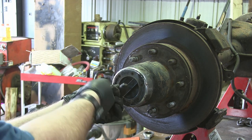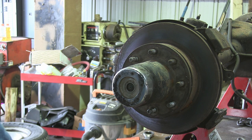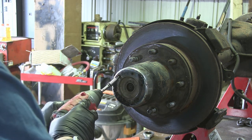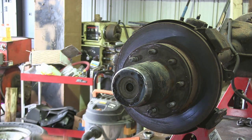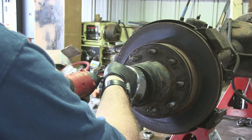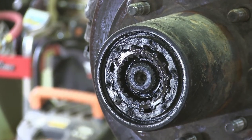Now we're going to start on the hub. First we need to remove the Phillips screw in the middle of the selector switch. On the outside, take these bolts out — they're a T20 on my truck. Remember this is spring loaded, so loosen up these bolts a little at a time. Before you take the last one all the way out, put your hand over it so it doesn't fly off. There's a little Phillips screw in there — we need to take that out too.